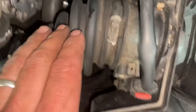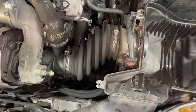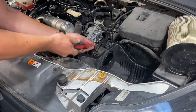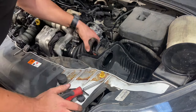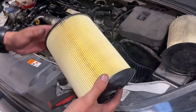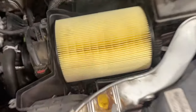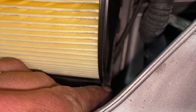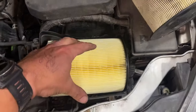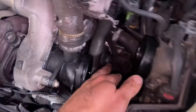Take that bellow off — the oil filter cap is just under there, so removing it gives a bit better access. Then simply fit the new air filter — make sure as you fit it in, it sits within that groove and runs in the middle of the channel nice and tight and secure. When you put the housing on the top it just traps it in. Run that back, put the cover back on, and nip that down.